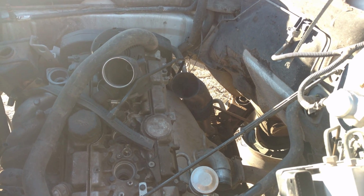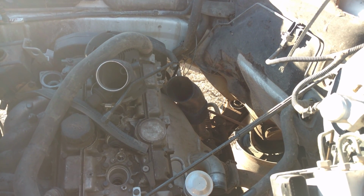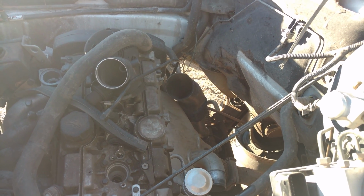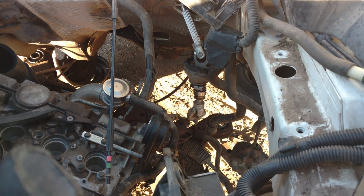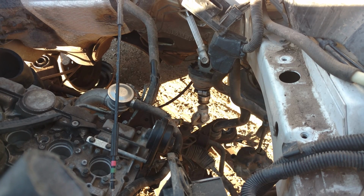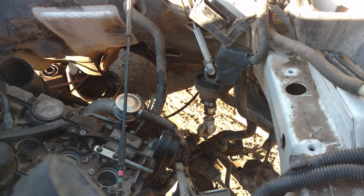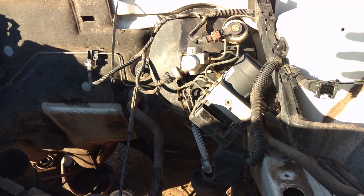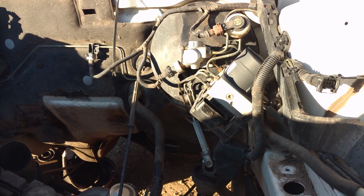You will probably need a throttle cable. Supposedly the manual cables are different than the auto cables. Not sure how and why. I just heard they are. They're about $50 new. Then you want the shift cables that are mounted on top of the transmission. You want to leave the bracket on the transmission and undo the cables from it. You'll need to pull them through the firewall. And you want the shifter from inside the car, and the cables or linkages are on the bottom of that. You'll have to disconnect those so you can get the cables from out of the dash.